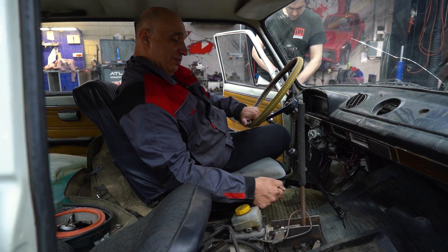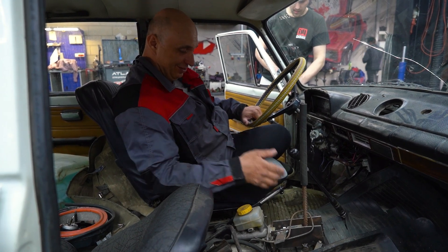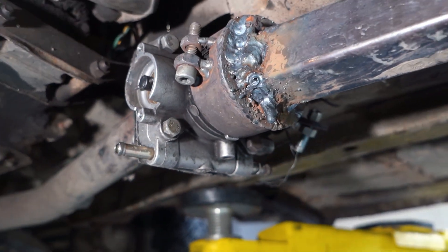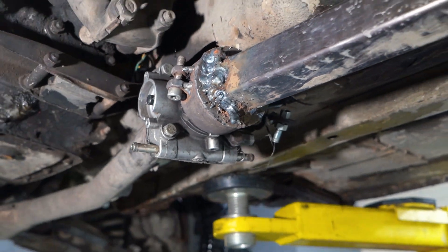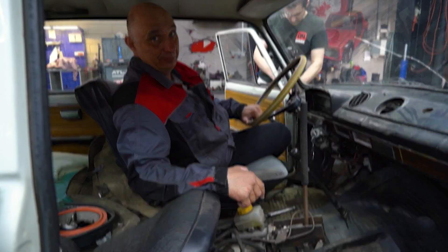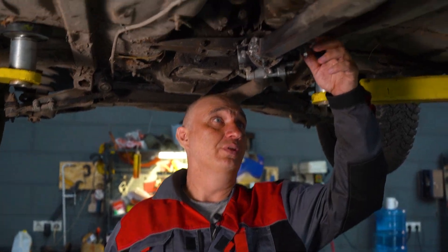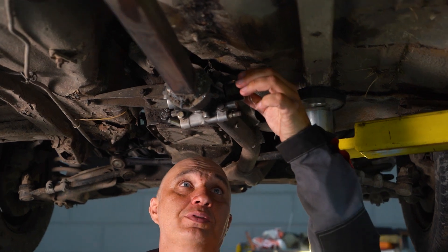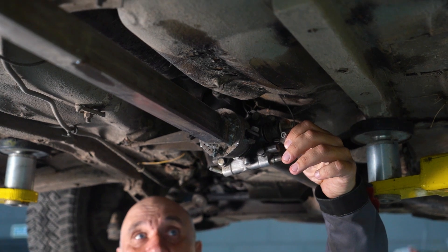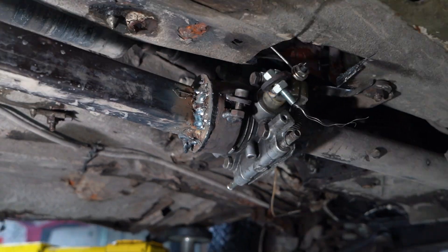We are gonna be activating it with this lovely lever. You can actually engage the parking brake and the car is not gonna start with the exhaust being blocked off. That's the retarder. The car didn't have a proper handbrake, so this will be filling its role. Now let's have a look from underneath the car. When you pull the handbrake, the cable pulls on the butterfly valve — so it turns and blocks off the exhaust, quite effectively at that.